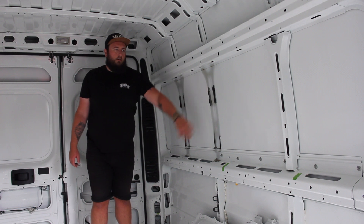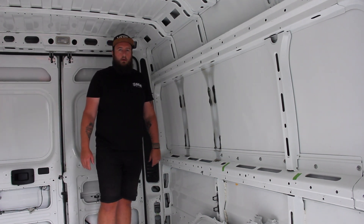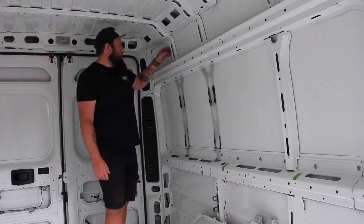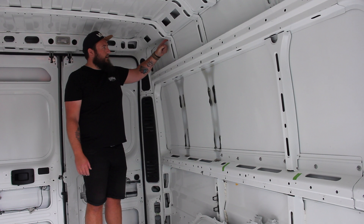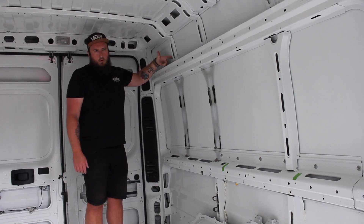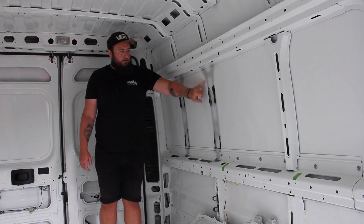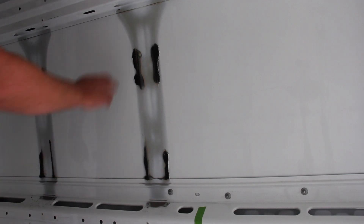We need to clean these up, get the silicone off, and get some sound deadening sheets onto all the panels. We're not putting windows in. What I'm also going to do is go around all of the existing ribs with some CT1 sealant and basically re-bond them all the way around. From the factory you can see they're only dotted on, so I'm going to do a full seam, and hopefully that will stop some of the vibration as well.